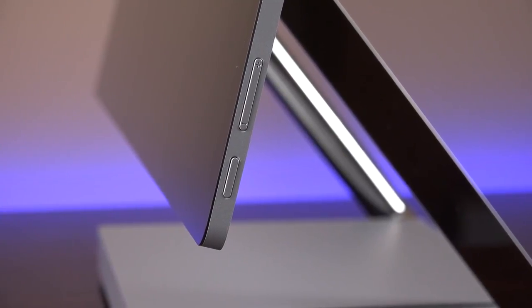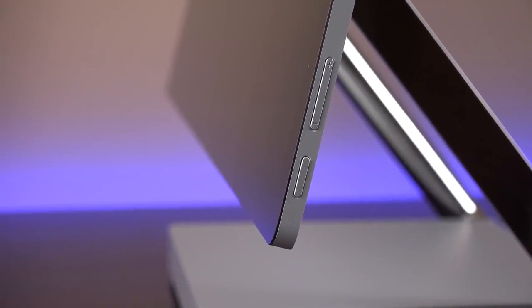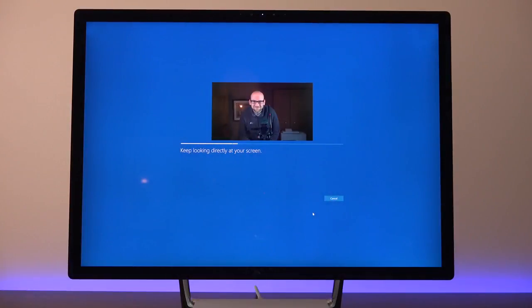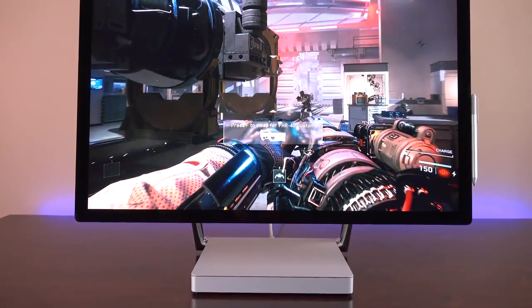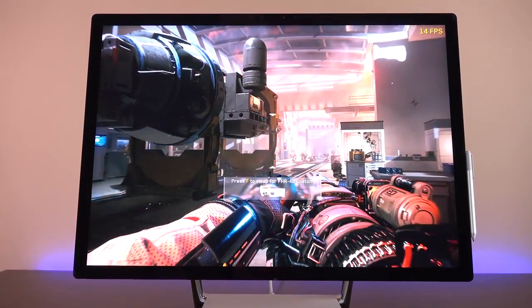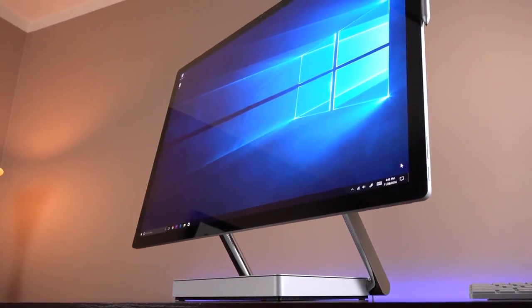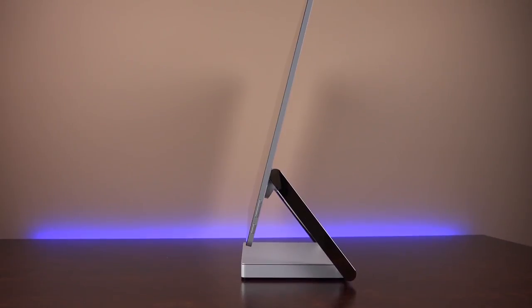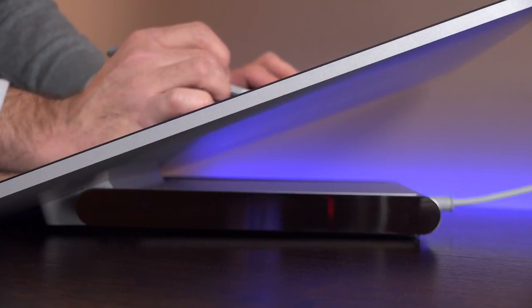The first thing I'm going to do is boot it up for the first time. The power controls and the volume keys are along the lower right side — very much like a tablet, which is a little unusual but really easy to access. The setup process does include configuring the Windows Hello feature, which allows you to use your face to log into your computer or make purchases within the Microsoft Store. Microsoft spent a lot of time focusing on the display technology here — this is a very unusual display in a number of ways. This is a 28-inch PixelSense display with a 3-by-2 aspect ratio. The display is laminated to the glass, and the panel is very thin at 1.3 millimeters — according to Microsoft, that's the thinnest LCD monitor ever built. The enclosure itself is only 12.5 millimeters thick, edge-to-edge.